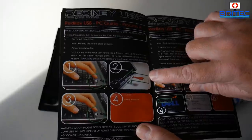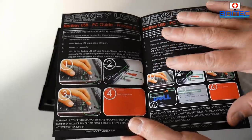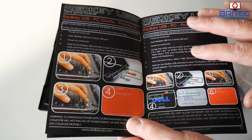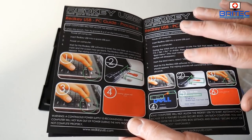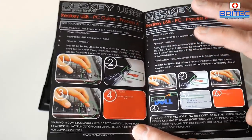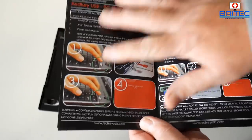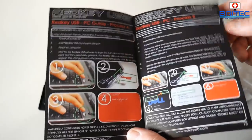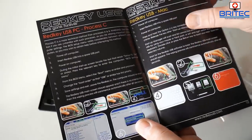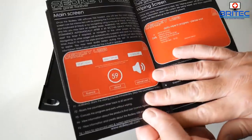We're going to concentrate on the Red Key, which securely erases any data on the drive. Whether you're giving the computer to a stranger, a charity, a school, or a recycling place, you need to either remove and destroy the drive or use a key like this. It uses overwriting methods like Gutmann or DoD to overwrite the drive with zeros, ones, and different characters to completely obliterate any data. You can also use this on Mac, and possibly Linux.